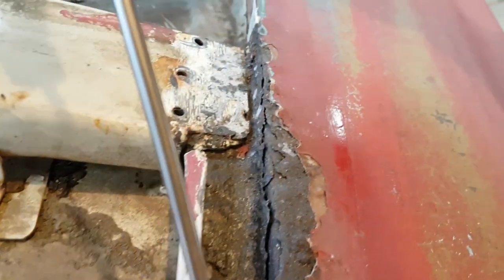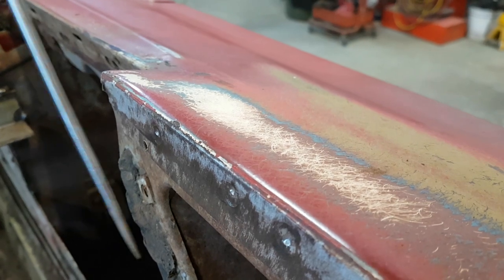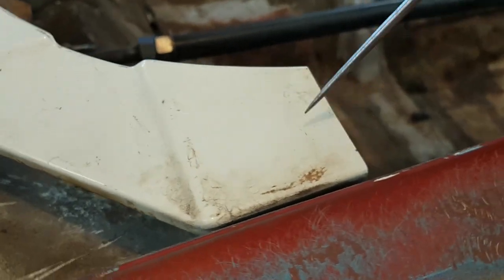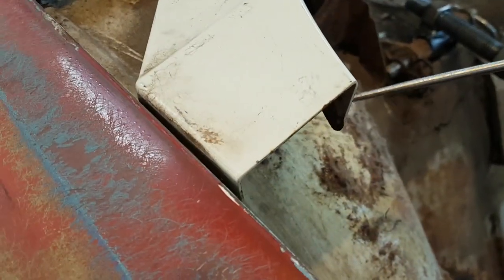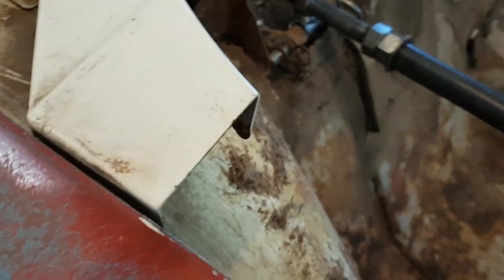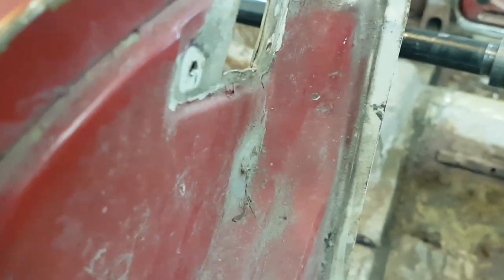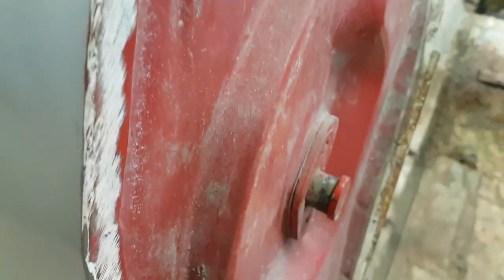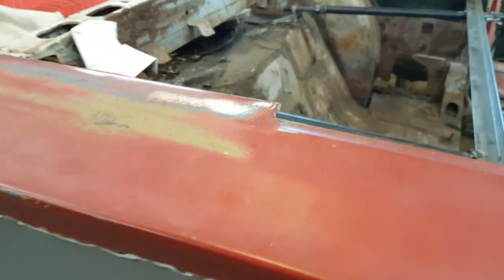It runs in there - we'll find as we go. And then there's spot welds along here on the inside. Because this just folds over on a flange. The only issue is going to be right here - it looks like there's a spot weld between this piece and the wheel tub, so I may have to cut out the spot weld and get it out of the way. It's all hooked into this wheel tub. And then there's spot welds down around the flange. Spot welds all down along - a lot of spot welding to cut free. So let's get at her.